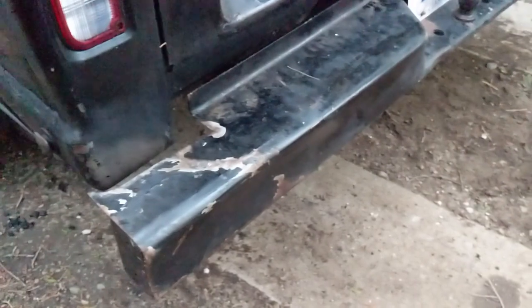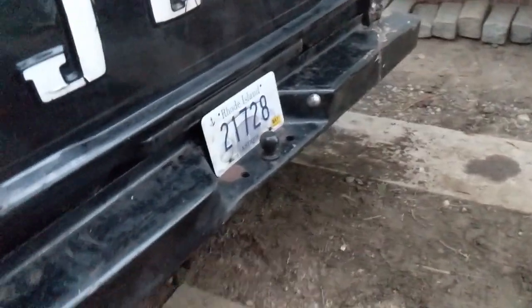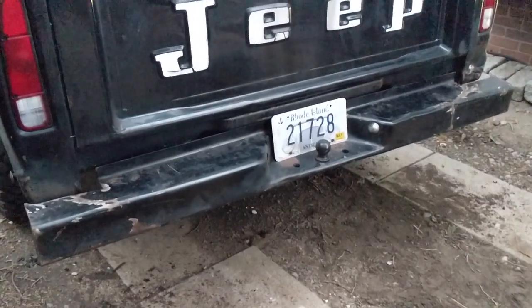Good luck with your own bumpers. Here is the straightened bumper. I also had another thing to straighten out — those frame brackets under there were really, really messed up. They were bent over by about four inches. So straightening those, banging out the body a little bit, and it's getting there. Now it's sitting where it should be, more or less straight, not bashed up against the body. Good enough for a beater truck like this. Thanks for watching — hope you found this helpful.